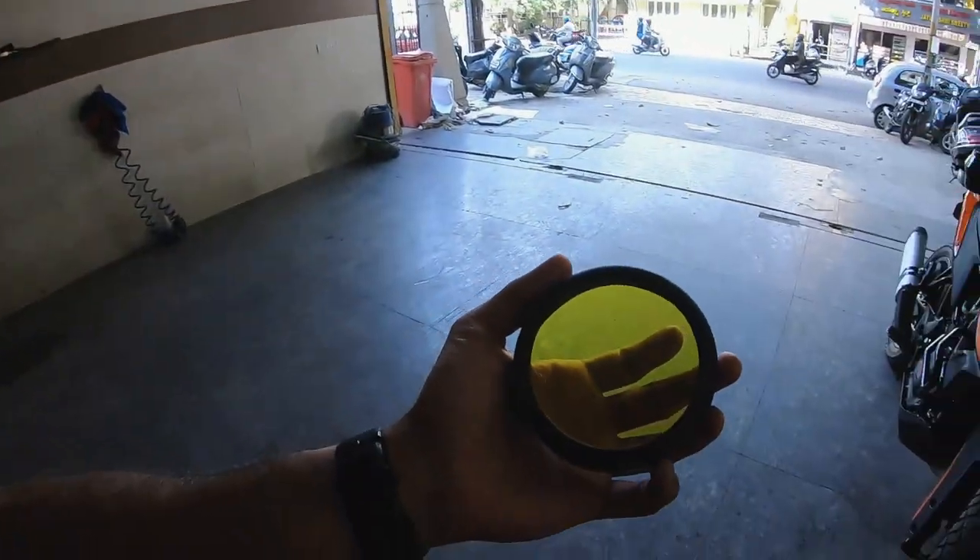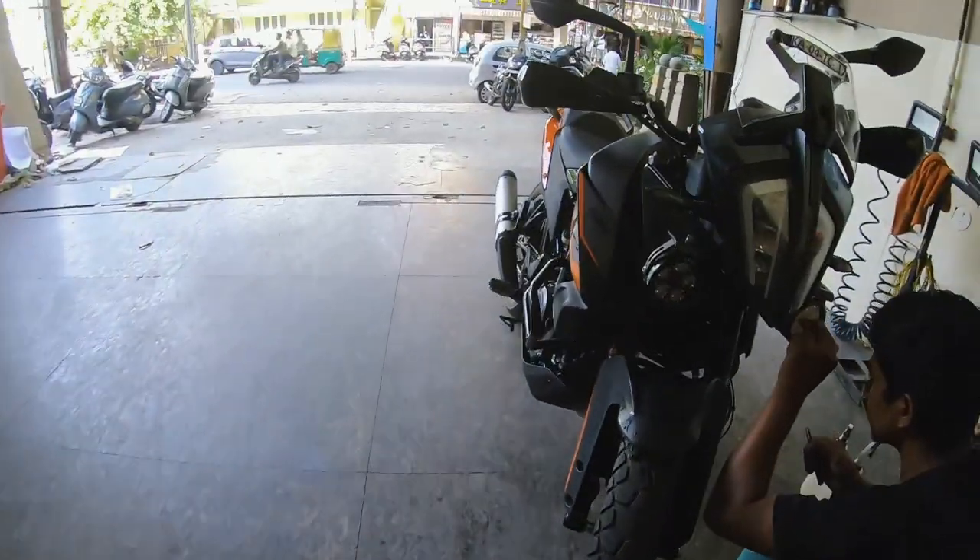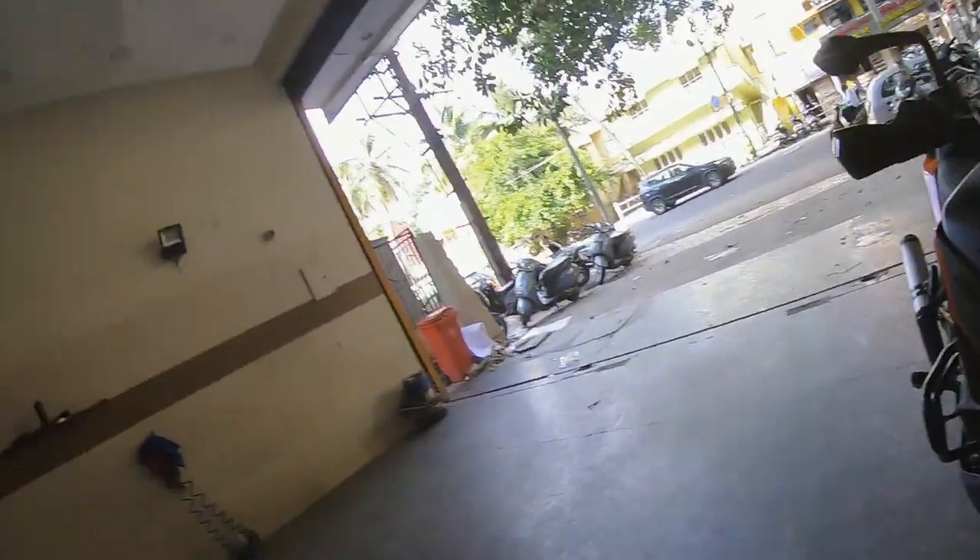After installation I'm planning to do a PPF on both sides of the lights. The reason being that when riding on the road there's a possibility that small pebbles and things like that can keep hitting the glass and I don't want any swirl marks forming. I can always remove the PPF and change it in future, so to get the best out of these products I'm doing a PPF on them.